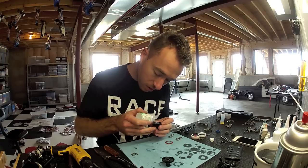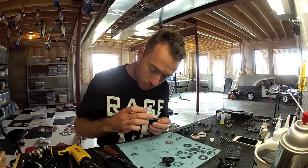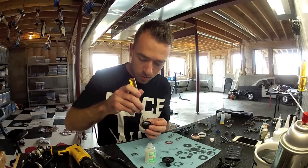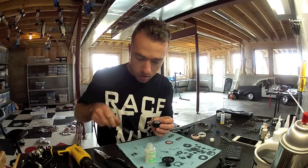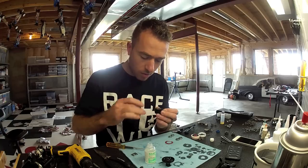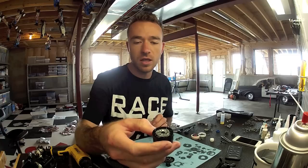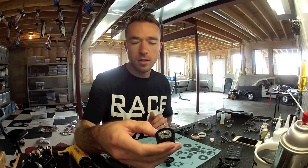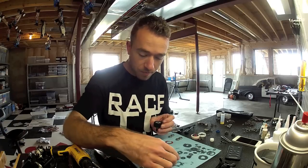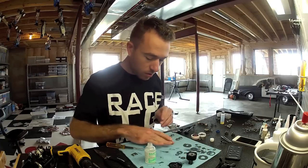Then I'll add a little bit to the areas where oil went away by the pins. Using a 2.0, I'll get the oil in where the pin will go. We're filled up just about perfect — you want it just a little bit below the edges of the diff case with all the cavities filled up. Then I'll line this pin up with the pins here and line up my pin with the screw holes. Next is getting my gasket ready.